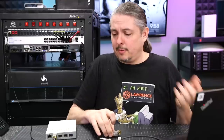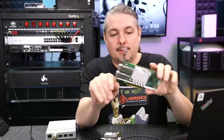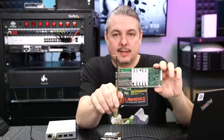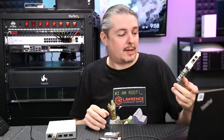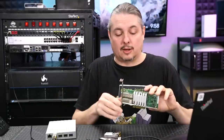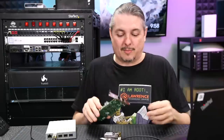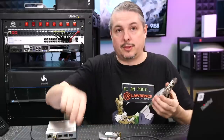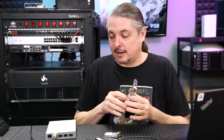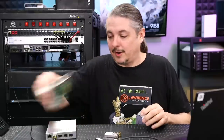One more thing I've mentioned before: this is an Intel 10G card — all of about $50 on eBay. The seller claimed it was new and it doesn't have any scuff marks. Mileage may vary on eBay, but overall they work really well. It's compatible with DAC cables or optical cables if you want 10G connections at a lower cost, and it gives you dual 10G that you could potentially bond together for even more fun — but that's a whole separate video.